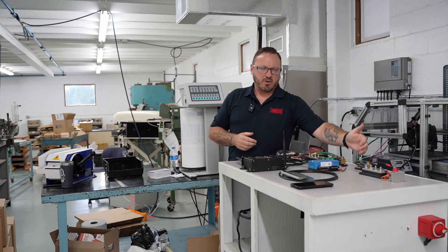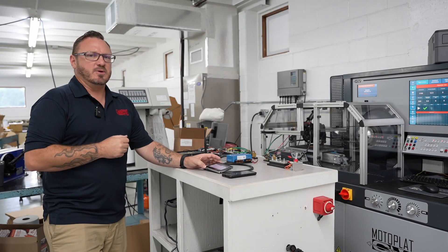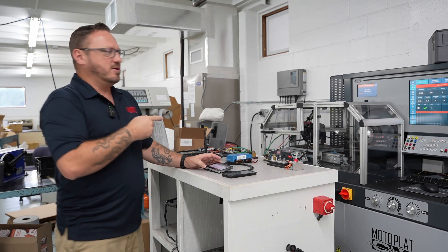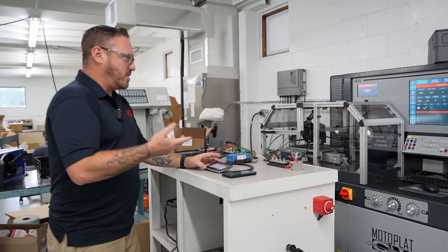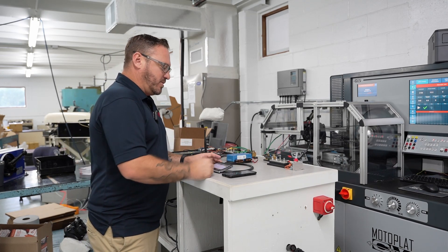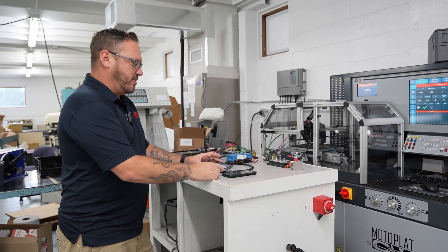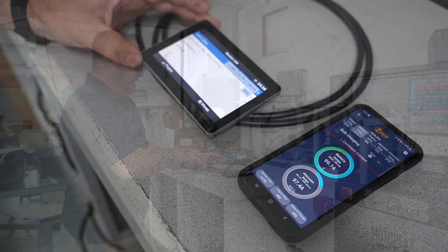All we're doing here is monitoring our alternator shunt to see what the alternator is outputting. We're running our Zeus high-output alternator, the A275L. You can see we're running it at 850 engine RPM, which is roughly about 2100 alternator RPM, at 43% duty, and we're putting out 97.3 amps — charging our battery very efficiently.